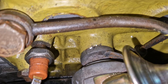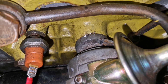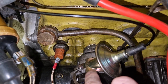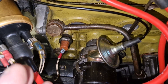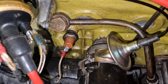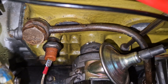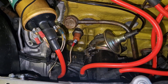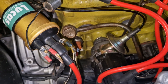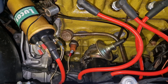You'll notice two white dots down there that I was using to line up my timing before we fixed the vacuum advance. What was happening is that because the diaphragm in here was broken, the little arm was pulling the timing plate round slightly all the time. So when I put the new one on, the timing was completely out. We gave it a quick check, and that's the amount of rotation I had to move it back to get the timing correct at idle. That's how you actually adjust it — different distributors have a slightly different clamping mechanism, but it's just a case of loosening it so you can rotate the distributor.